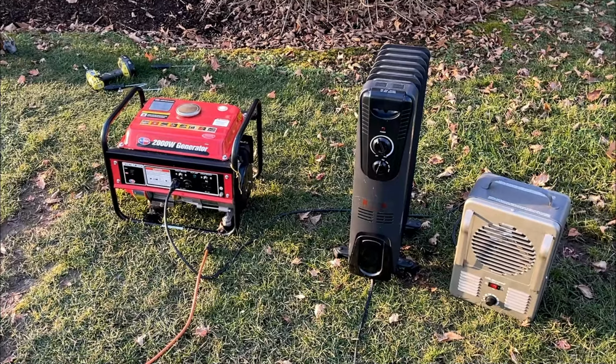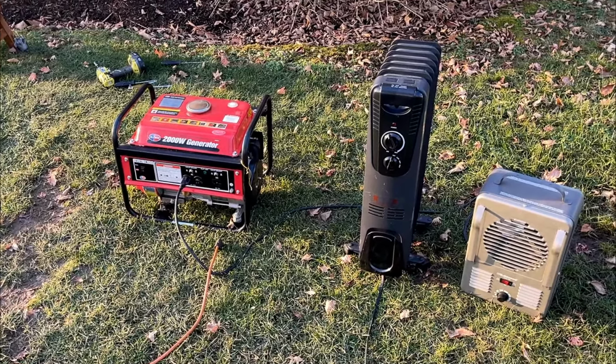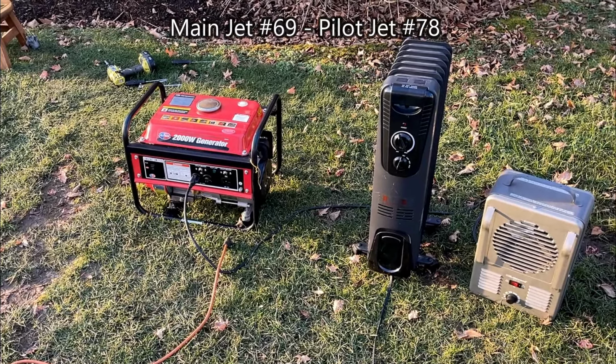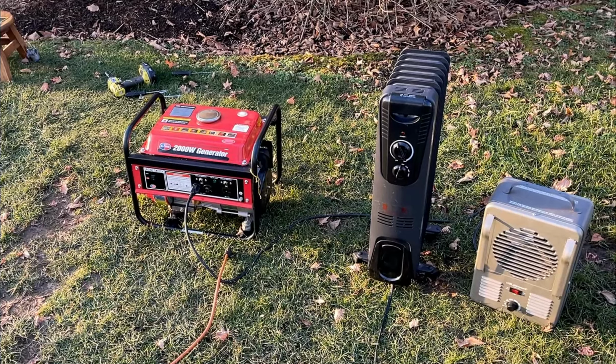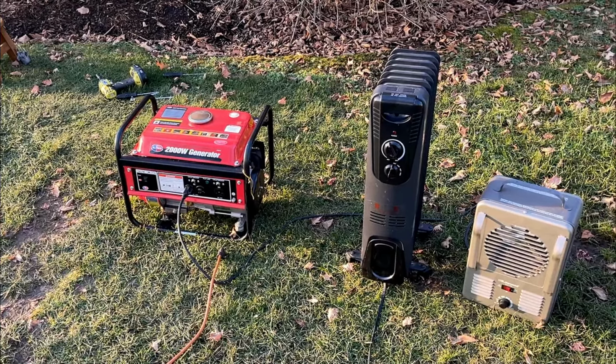But even the new carb was struggling. I had to drill both the jets out. I will leave the drill bit sizes in the description in case you need to do the same. And now that that's done, it's running pretty well. I wouldn't say perfect. It's still oscillating a bit under load, but it does work itself out.